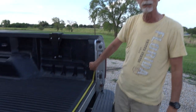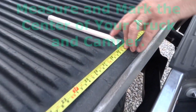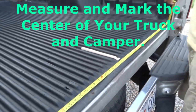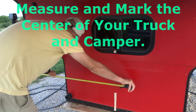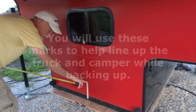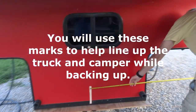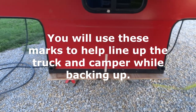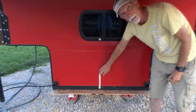One of the first things I do is measure across the bed of the truck — it came out to 60 inches. I found the halfway point at 30 inches and put some duct tape down. I did the same from the inside of the jack and it came up to 49 inches to the middle of my tape. If you notice, it doesn't line up with the middle of the window, which is why the tape marker is important — looking through the rear mirror I can line it up and push it right back on.